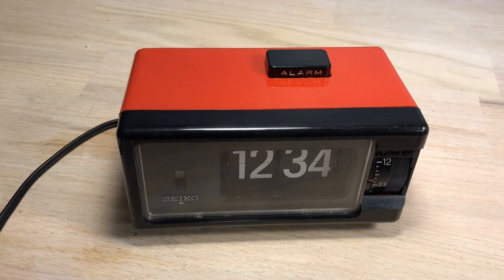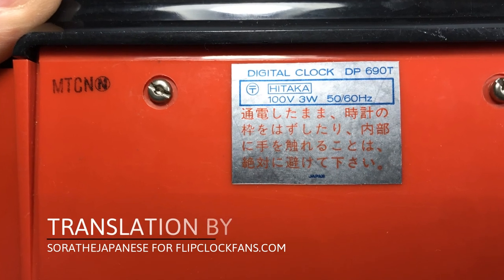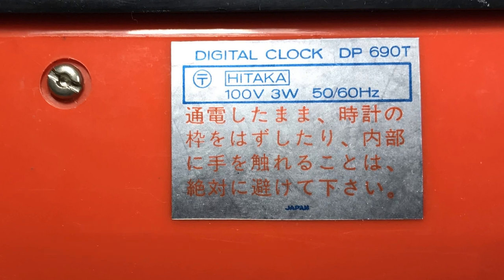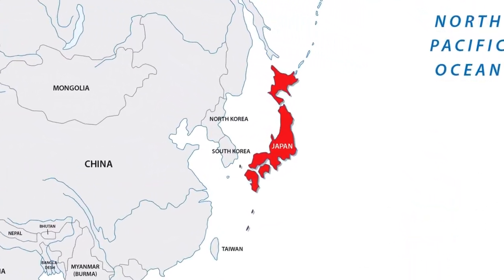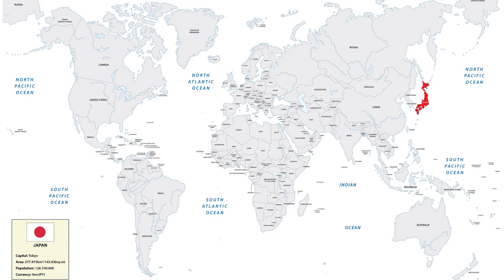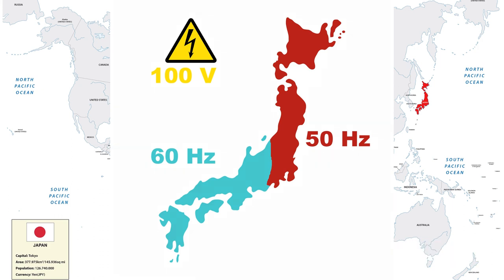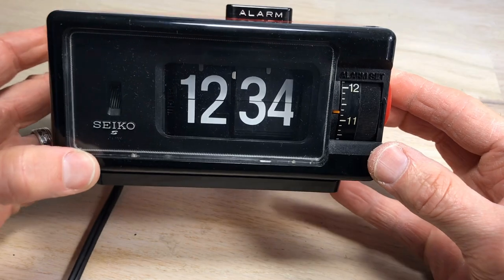The clock is smallish in size and has nice colors. The warning label says: don't remove the frame of the watch or touch the inside while keeping the power on. This clock was made in Japan for the Japanese market. Japan runs its electrical system unusually — the western part of the country runs at 60 hertz and the eastern part at 50 hertz, but the whole country runs at about 100 volts. And that's what this clock is rated for: 100 volts.